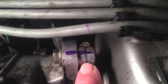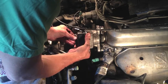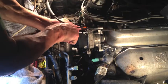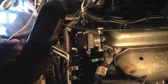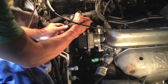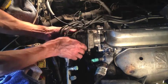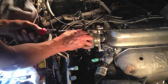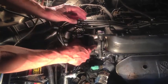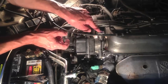Ready to go back on the car. First thing for reinstallation is find the alignment mark on the distributor and line it up with the mark on the engine, so you know you have it in the exact position it was before you took it off. When I first put the distributor on, I was turning the rotor, which was turning the shaft of the distributor — you're going to have to turn it a little bit to get that shaft in the right position until the metal meets up here. You'll feel it when it happens and you'll see these two pieces of metal meeting flush, then you can put the bolts on.